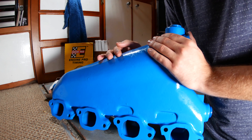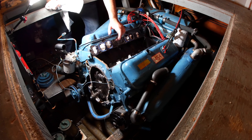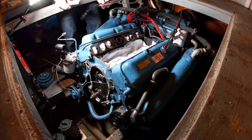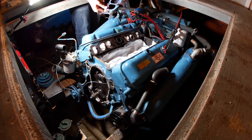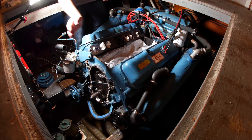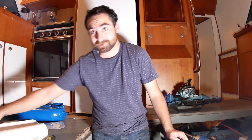That's an amazing thing I never thought would happen. So here are our parts — we just gotta make them fit in the places they're supposed to. I need to take these old gaskets off and clean up the inside. Make sure there's not even a speck of paint in there. All the mating surfaces have been scraped within an inch of their lives — even the ones on the intake manifold. Completely clean: no dirt, no gasket grime, no little chunks. They're all off.